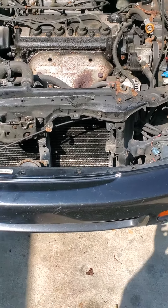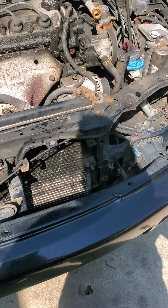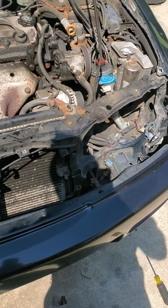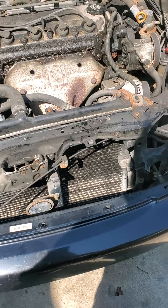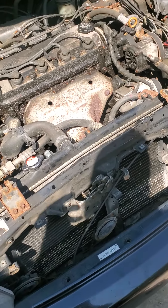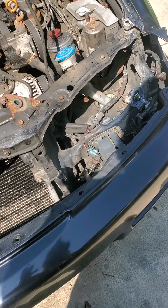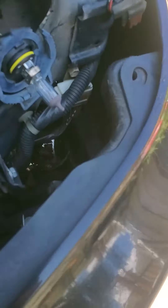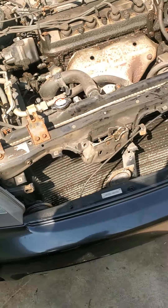...it all has to do with the bumper coming out. In my case, I bought this car that hit a deer, so I have to take off the bumper to get access to remove the fender, and then I'll be able to take out and replace the headlights. The issue with these Accords is they made it old-school — you have to take off the whole entire bumper first before you can take anything out of it. They're held in place by screw clips in little holes, but they put them right underneath the headlight, making it so you can't easily gain access.